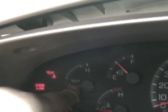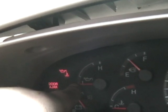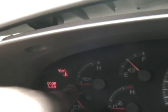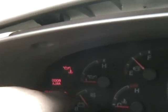Well, for whatever reason, neither one of those is doing the job for me. Now either my gauge is broken or I'm not getting any oil pressure. I suspect it's probably correct and I'm not getting any oil pressure. However, I do not have a manual gauge at the moment to test with, and if I did, I'm not really sure where to hook it, so maybe you guys can comment below and let me know. I'm kind of stuck, I'm kind of puzzled. I don't want to start it without priming the pump first.